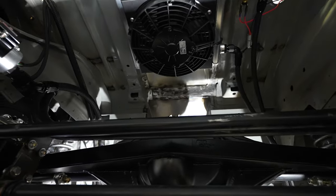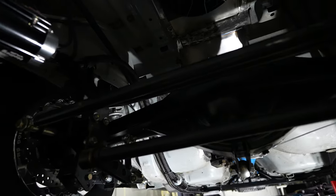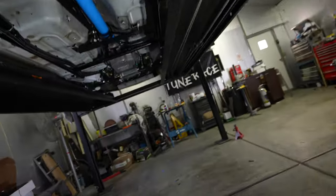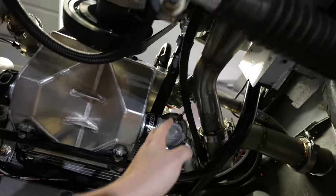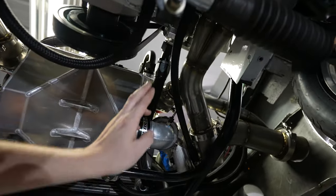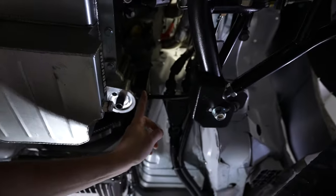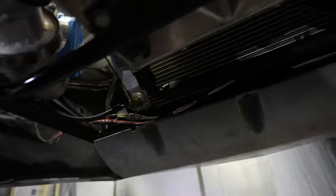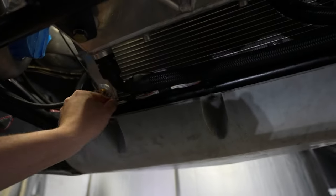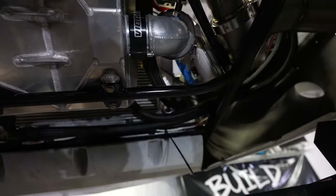If the fluid in the trans cooler is hot, the fan will run even when the car's sitting in the pits to keep it cool. That works out well — instead of a switch that dies with the car, I leave it on and the battery is plenty to keep it alive. Still need to hook up my sway bar mounts. This is the stainless line that reads off the turbo feed. I also built the turbo drain lines; I still need to clean those out and hook them up completely. The turbo feed line comes up around and tees to each turbo.